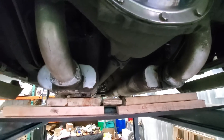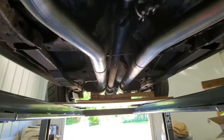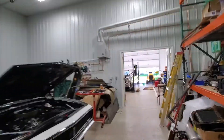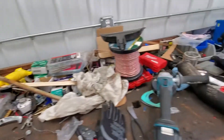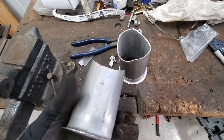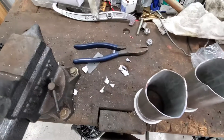It's the next day. I've been futzing and rehanging because we really do want to tuck it a little higher. The problem is tucking this part of the floor for the convertible secondary frame. Before we tack all that, I figured we'd come in here - I don't have a fancy tubing notcher and I can't justify the expense - so between a diamond wheel and a grinder you can just start playing with it, working your way in until you've got something tight enough to weld. These are getting really, really close. Cut out a large chunk with the cut-off and then just been grinding.